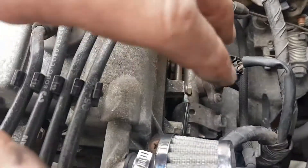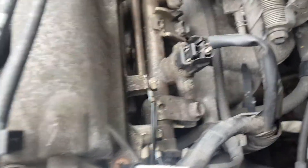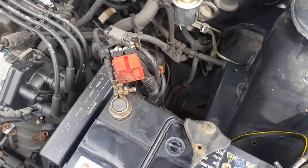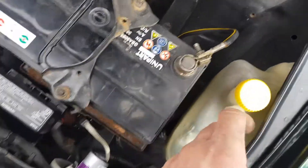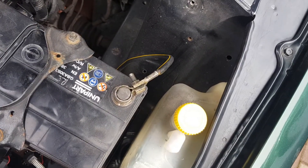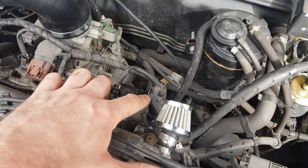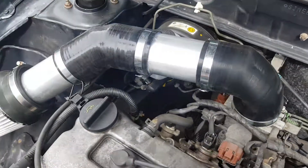I've tried to hide it at the bottom but yeah, the filter's gone rusty, so I'm going to get a better filter for it. That bracket I took off - I took it off and bolted the earth straight to the block, which looks a lot tidier. One thing you have to do to get that black pipe that runs down here off the standard airbox is take the battery out, then take the bolts out of the battery and just move it out of the way so you can get to the bolt at the bottom.